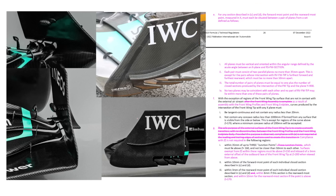However, something that slipped through that no one really noticed is that they also changed another part in the rules. This particular part that they changed struck out a component that said the sole purpose of the surfaces within that tip legality volume is to create a smooth transition with no discontinuities between the front wing profiles and the front wing endplate body. That requirement has been removed, and so what they've been able to do is use that to allow this particular discontinuity.